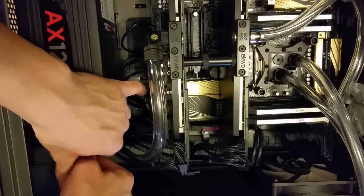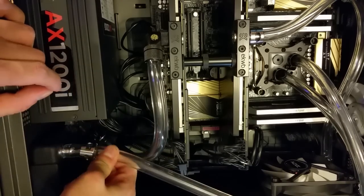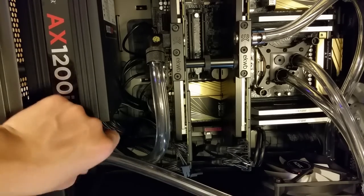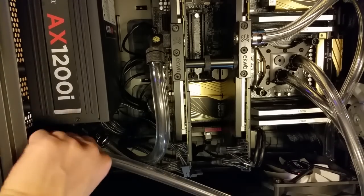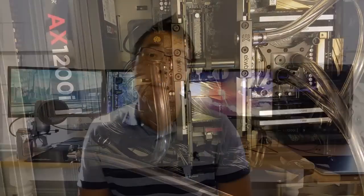Another performance consideration for water cooling your system is noise reduction. Unfortunately, when your system is idle, air cooling will outperform most water cooling setups because you have additional noise coming from the pump. There are some quiet optimized pumps that you can tune so they operate at lower frequencies at low loads and aren't as noisy, but even those mechanisms can be loud compared to just fans using air cooling. Therefore, for project recording workstations and quiet optimized builds, water cooling is a no-go.